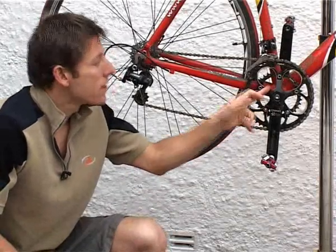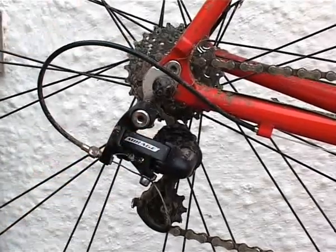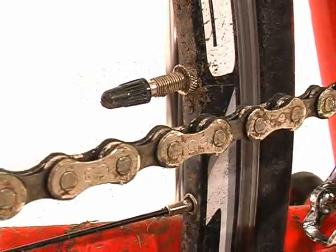By far the most important part of your bike to clean is the drivetrain, which includes the front sprockets, the chain, the rear cassette, and the derailleur. This is because over time oil, mud, and grit mix together to form what is effectively a grinding paste that, if left on your drivetrain, is going to wear components at an alarming rate. So if you're suffering from a lack of time or motivation — or in my case sometimes both — it's better to clean the drivetrain thoroughly and forget about the rest of the bike than do half a job on the whole thing. It's also good practice to clean the really filthy parts first, so that's why we're going to start here.